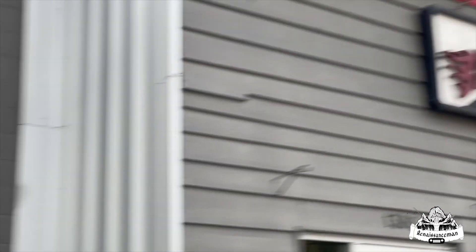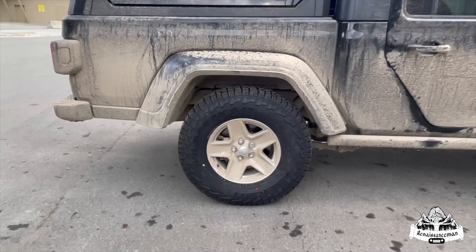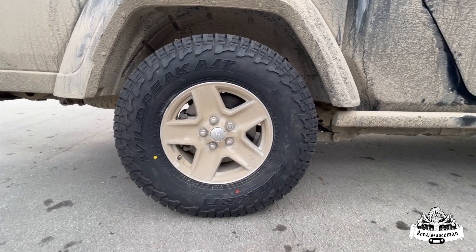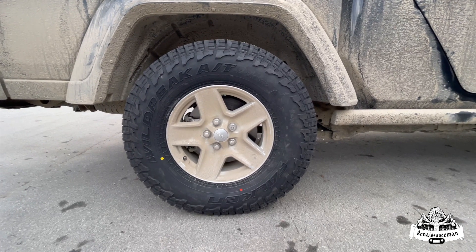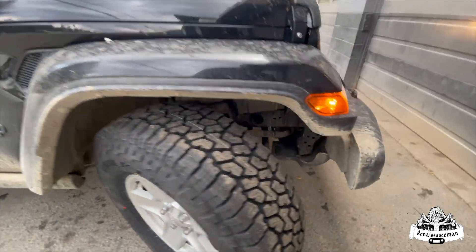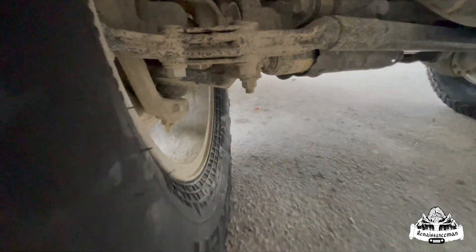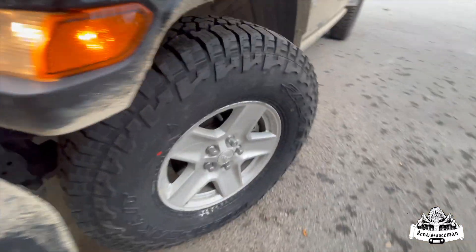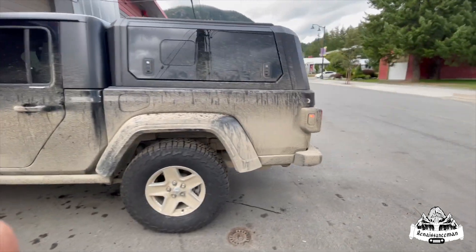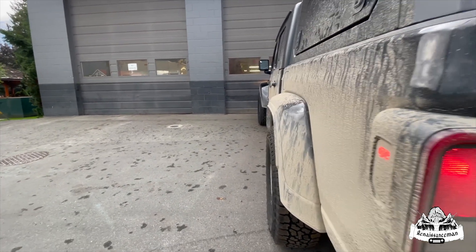Just leaving Black's Hot Wheels — got the new tires on. Falken Wildpeak All-Terrain 285/75/17s, 34-inch tire, 11 and a half wide. Got the wheels cut, no rubbing.